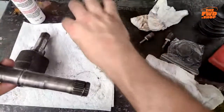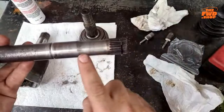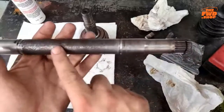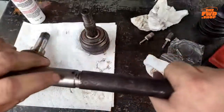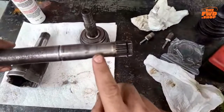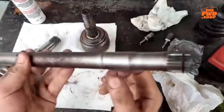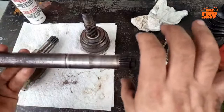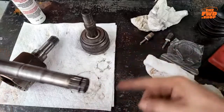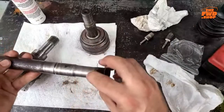And some of these axles are way beefier than others. I've got bigger hands. You can see that axle shaft is almost the size of my thumb. The smallest part of that axle shaft is basically the size of my thumb, give or take a little bit. You can't go off this part right here because these are covered with boots. You can't go off that because even right there's a groove, so it's smaller. But this one, next down, so you've got to go off the smallest part. That is the weakest part of your axle shaft. It doesn't matter if that thing was that big around, if it's coming into this point. So if you've got really tiny axle stubs right here, that's the other thing to remember: you've got this small shaft. If that tire's spinning and spinning, and all of a sudden it bites, that shock load gets transferred. If this is stronger than that point right there, you're going to snap them.